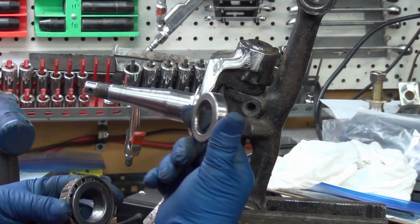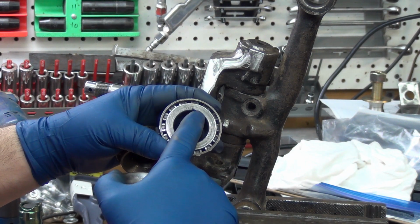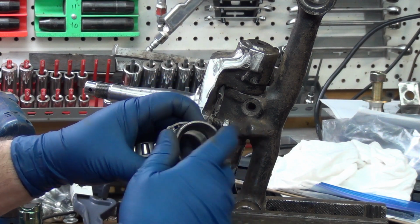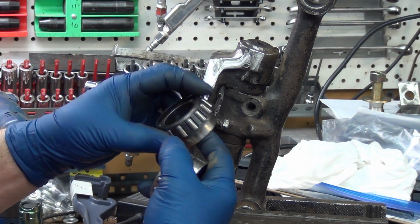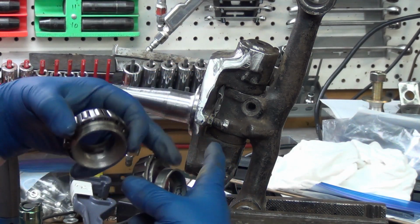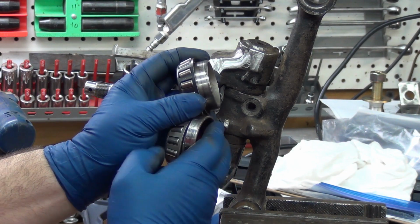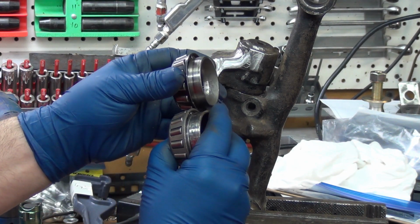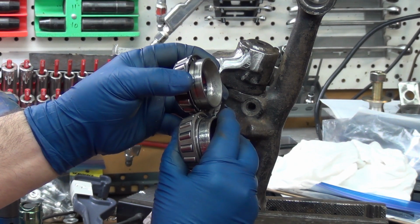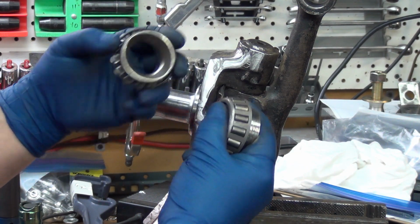The 521 has this spacer at the bottom, and it goes with its bearing. You'll notice its bearing has a fairly hard shoulder here. 32K BO2. This is a 32K BO2/11B. All the dimensions are the same except for this spacer is built onto the back here. Now the two combined, it's kind of hard to tell here, but there's about an 80 thou difference.